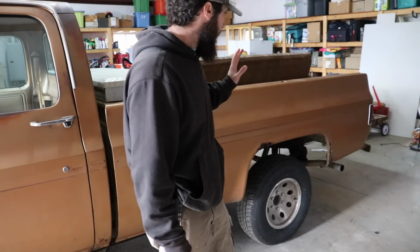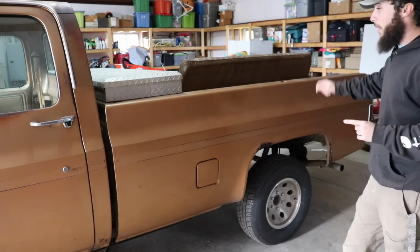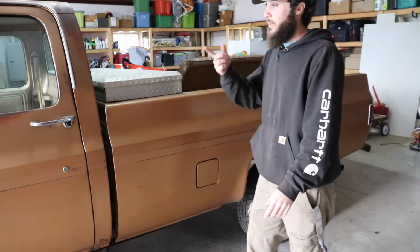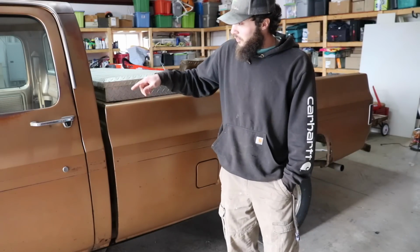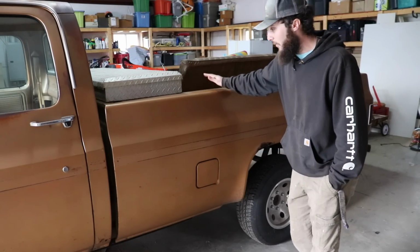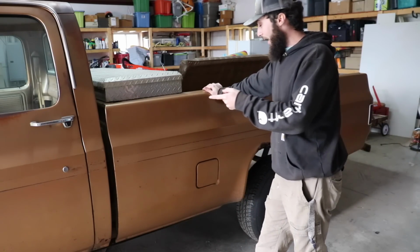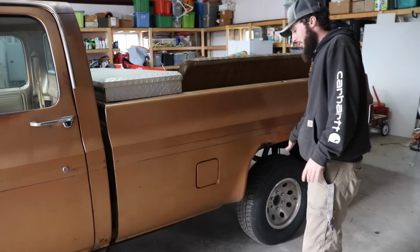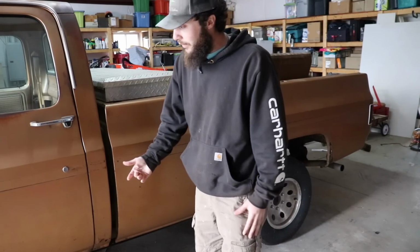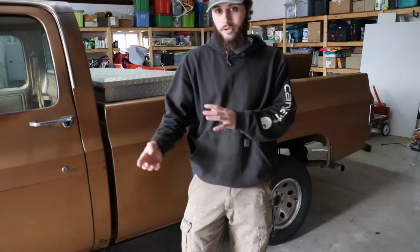So I have an idea how we're going to rig this up, so the next video is going to be pretty exciting, because this puppy's coming off. We're going to go ahead and restore the frame. We're tackling the cab corners. We'll do the inner and outer rocker, and then this will be off the truck. I'm not sure where we're going to put it yet, but once we're done with that, we can tackle our 2 rear fenders, and then from that point on, guys, there's just a couple small little tedious spots that I might be able to just fill in with the welder.